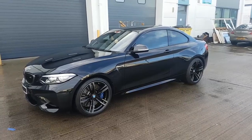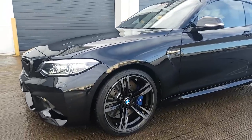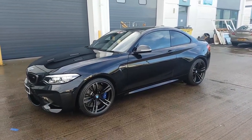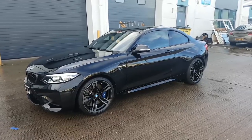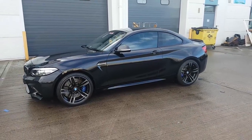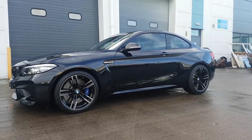What we're going for today is the H&R lowering kit - the performance lowering kit - which drops it about 30mm at the front and 20mm at the back. Springs are a direct swap, like for like, there's no modifications needed, and it should improve the handling and obviously the looks. Lowering springs do give a slightly stiffer ride but provide better control and less roll in the corners. We'll get it inside, take the wheels off, take it up in the air, get the springs out and replace them.